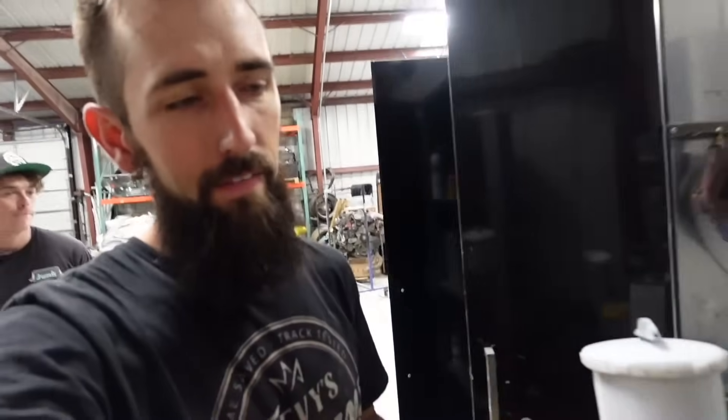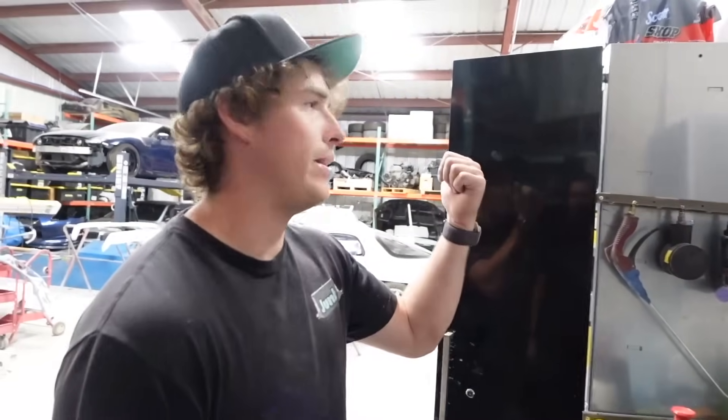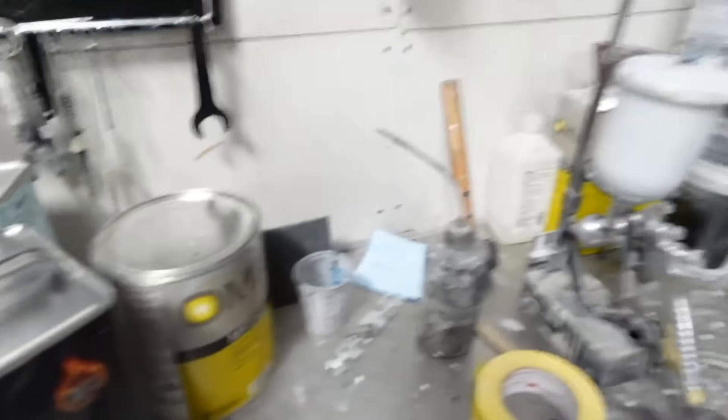My key with painting stuff, especially with clear coat, is to just watch the panel and watch it basically turn to glass and get wet. Just as soon as it gets wet and it's all even like a piece of glass - smooth, wet - you stop. You don't go anymore. The second fender came out a lot better - I was really consistent, kept that six inches of range, and was just nice and consistent throughout the whole stroke. So now Trev doesn't have to prime anymore. I'd much rather do that than wet sand all day - no fun.